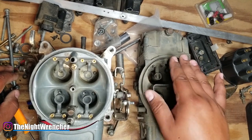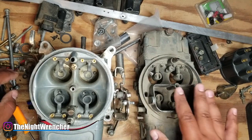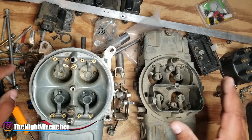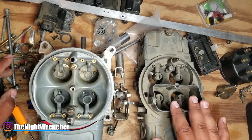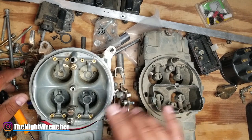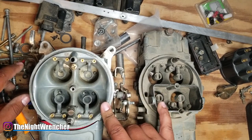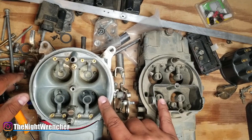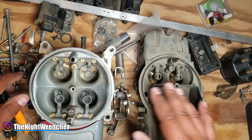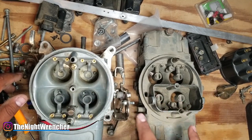There are people that tune their carburetors on the street and run them on the track — of course there are — especially if you set it up closer to a richer tune, that gives you enough breathing room so when you stab the throttle you're in a safe spot going down the track. I could go on and on about all the differences between a street carburetor and a race carburetor, but you'd be here for hours. I'm going to post more videos soon going in depth about everything I talked about today. I'll see you guys in the next one — Nightwrencher out.